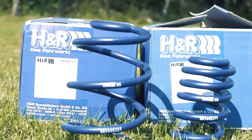We'll cover T30, T32, T5 through to T6.1 and the various options. First thing to note is that a T6.1 is different to a T5. T5, T5.1, and T6 are all the same - T6.1 changed the front damper, so the spring sets and seating are different. If you're doing coilovers on a T6.1 it's irrelevant because you're removing all that suspension anyway.